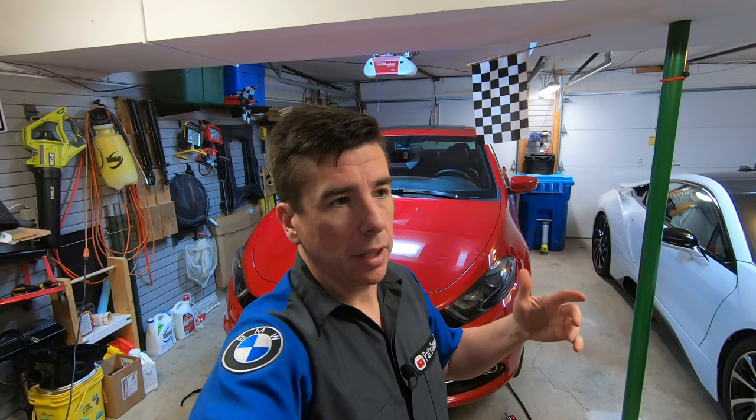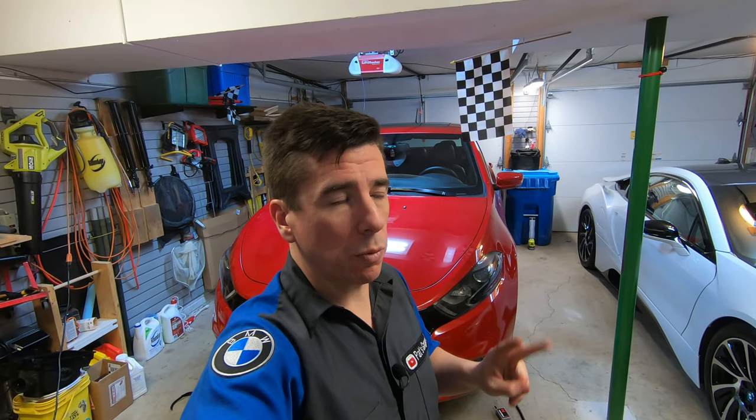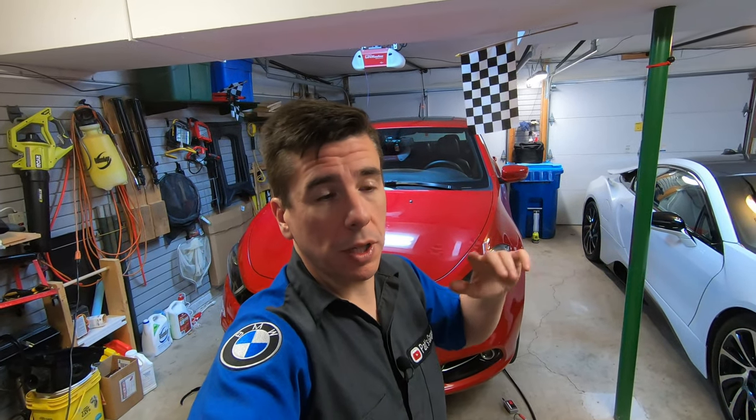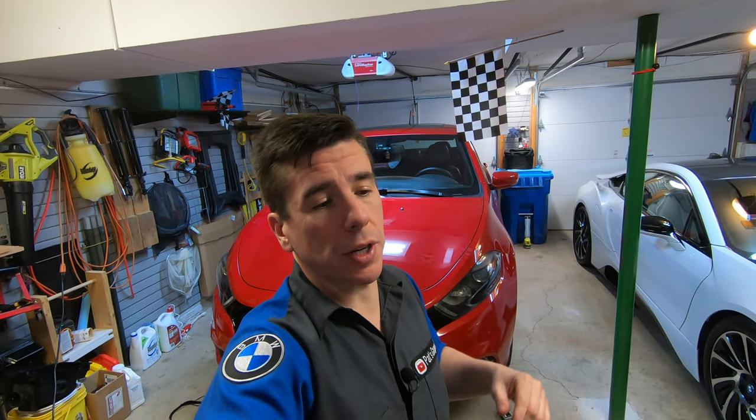Well, I'm back at the garage. I wasn't too sure about my results initially as to whether or not I was really getting noise from number two more than number one. Something didn't seem right. So I brought the car back and I switched transmitters. I put two on the left side and one on the right side. And I also switched the leads because maybe there was just a problem with the disconnection. Well, it seems like there's something in the vehicle that's actually causing interference with the wireless system, so that it's difficult to find out exactly which bearing was the problem.